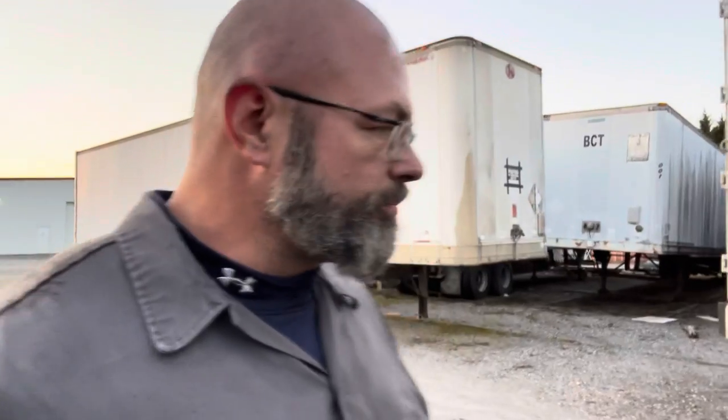All right, guys, so I went back down underneath the truck and I pulled out that fitting combination, took it all apart, re-cleaned the threads, and there was a little bit of like a hard sealant that had got trapped in there, and I guess I missed it the first time. But I got it out of there now, got it all sealed back up, and everything seems to be good. Now, I was gonna do a few other repairs on Goliath while we were here, but as you can see, I am losing daylight very quickly. So I guess that's gonna be it for today, and that'll be it for this video.